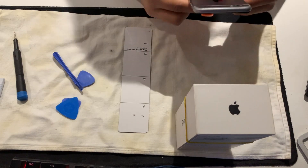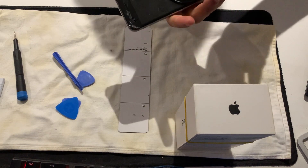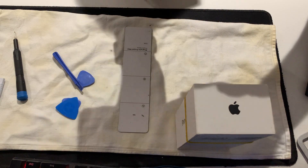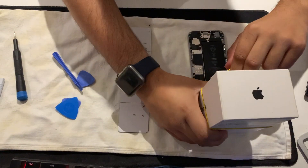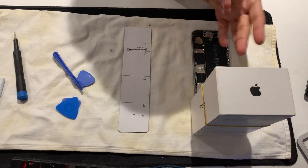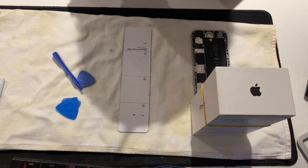If you can't turn it off, make sure you always unplug the battery so you don't damage the phone. Open it up like so. Take the suction cups off, then you get the broken screen and you can use a box or a 90-degree stand to prop it up, and then get a screwdriver.